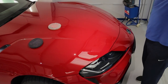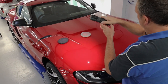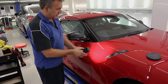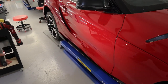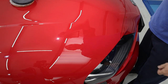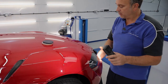You do see people with buildings — all their buildings have got white walls or black walls. There's a common trend now for dark grey or black walls to do this effect. But you don't need dark walls — I want bright white walls. So when I'm doing general detailing, it's a lovely flooded light surface for looking for dirt round edges and doing interiors. When I want to do polishing, I might want to turn these off — if you can make the room darker, you can see defects better. So the further I come away with the light, the easier it becomes. This theory works with polishing marks, sanding marks, water stains, bird poo, etching, prep marks in paint, dry paint — you want to be further away with the light source.